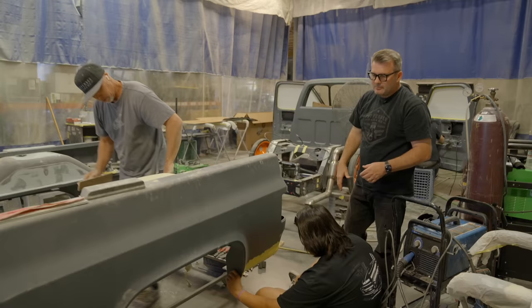He has to start with 600 grit and a hard block to knock all that stuff down perfectly flat, then take it slow without overdoing it or removing too much. Around edges and certain little areas he's careful — he'll start those at a lighter grit like 1500. The big body side is super important because that's where you'll capture light rays and see if it's flat or not. Once cleaned and polished, they'll take it in the booth, spray bed liner on the bottom, and then this will be ready to go with the cab onto the chassis.